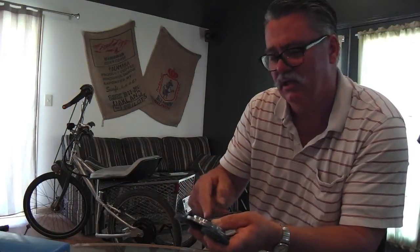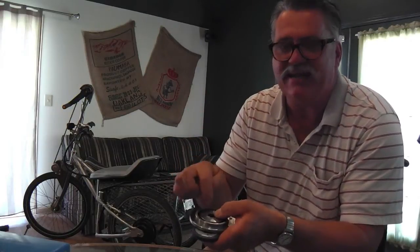And I thought, well, that doesn't look like much, but sure enough, I plucked it out, and within that caged bearing set were also these little triangles, these little roller cam things, and that's what gives the clutch action. As soon as it is energized with this spinning small gear in the center, it locks those in, and these babies start spinning, and that is what gives you the wheel power action.